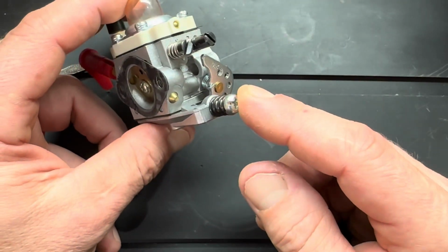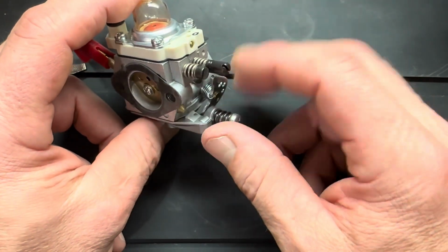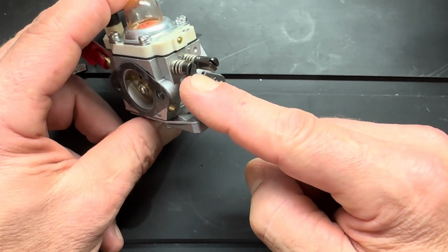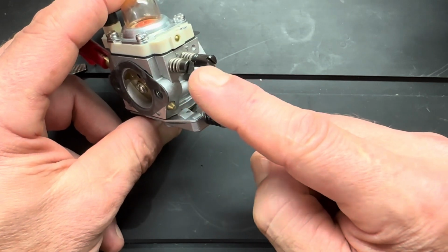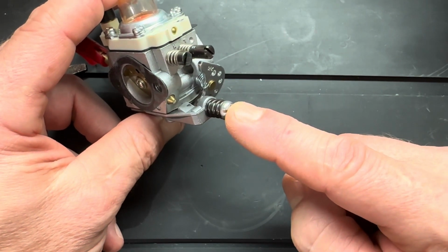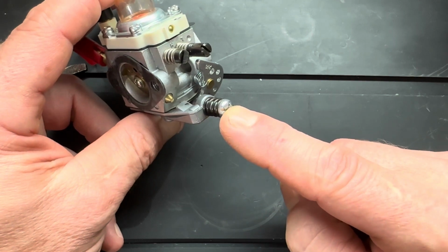You adjust the idle after your tune is set, okay? You know you got your tune right. You've done set your low. It's taken off great. Then you listen to the high wide open, there's no gurgle, and these two are working in conjunction perfect together, and you know they're set right, and you bring it back, and it's just going ding, ding, ding, ding, ding, and it wants to cut off, then you crank your idle up a little bit.